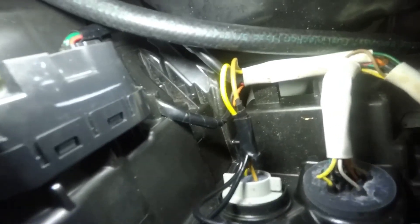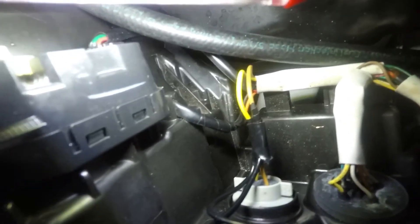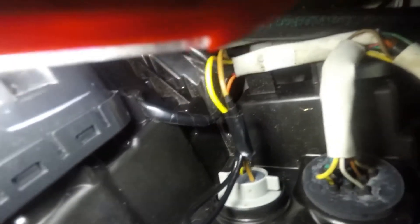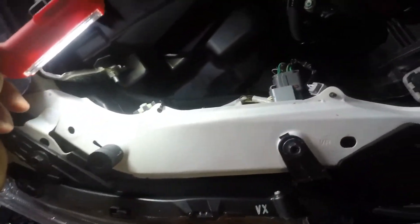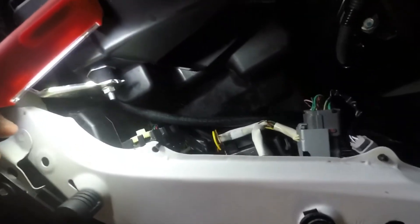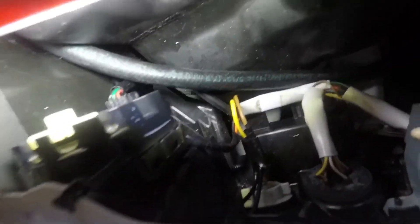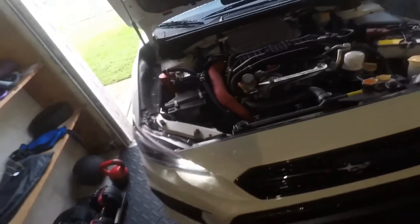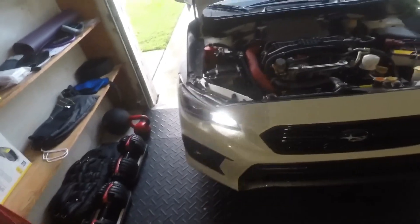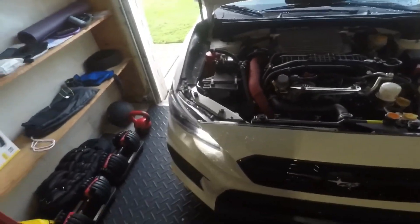So what I did was split the two wires coming out of the blinker bulb and connected the two black wires — it does not matter which one you connect to for the hyper flash fix. I have the load equalizer tucked away underneath this metal piece here. You want it to be next to metal or touching metal because it does get really hot — you do not want it on any plastic. Did the same thing to the other side. Simple, easy modification — I think it looks badass. Any questions or comments, leave them below. Thanks!